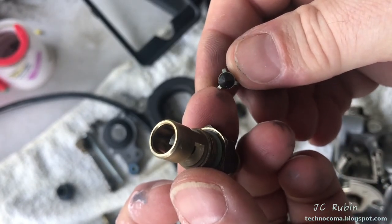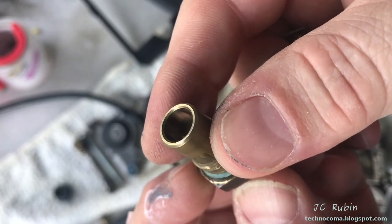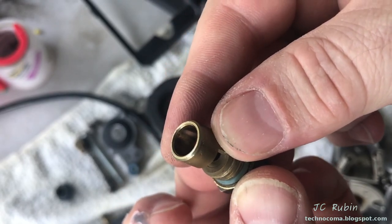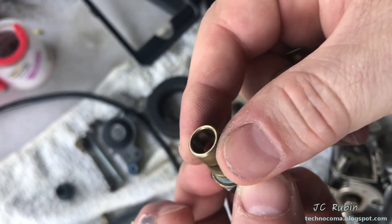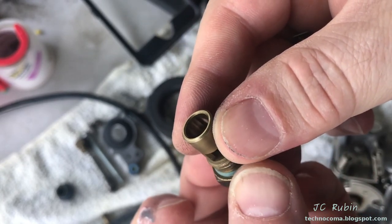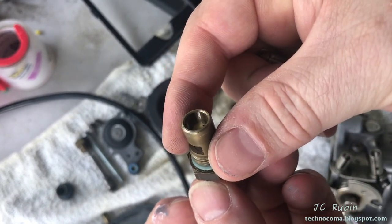I've got a couple of Q-tips with metal polish. I'm going to polish the inside of this race here. Once I polish it I can inspect it and make sure there are no gouges forming, then I'll polish where the seat is for where the rubber on the needle blocks the actual hole on the bottom. There are three ends of the needle situated here in this brass fitting. Over the years with vibration it has slowly worn into the brass — we can see three silhouettes in there. It's very mild but it tells me it might be time to think about changing this out.